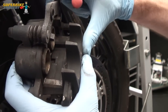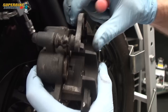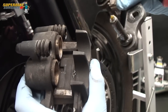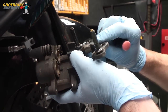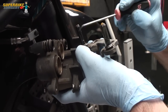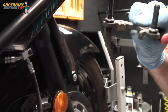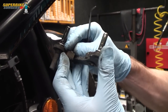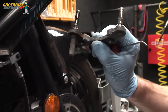This type of calliper is a little bit more complicated than a four or six-pot because it's got this sliding mechanism here. What we do is pull those gaiters back and slide this out. This is in good nick because the bike's done very few miles, but often these are all dry and corroded and need to be cleaned and greased. There's also another little piece here that comes off - that's just a little seat for one of the brake pads.